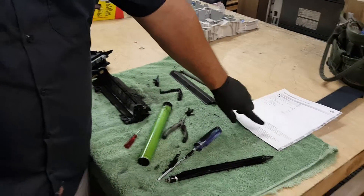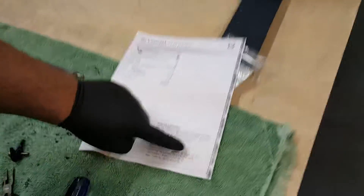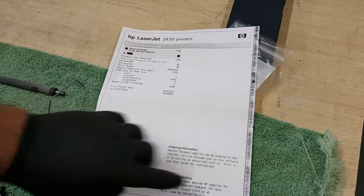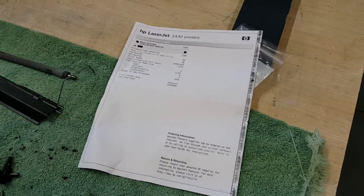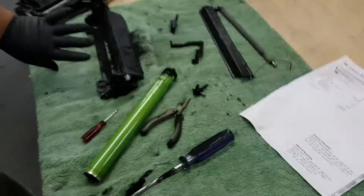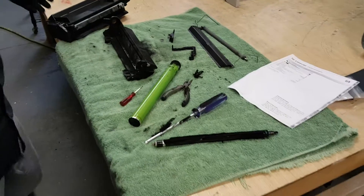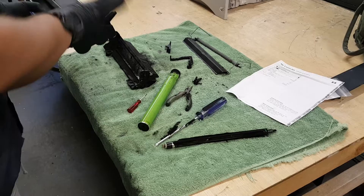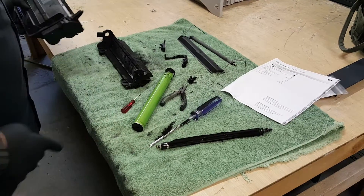What you can see here on this page is the image defect you get — it's spilling out that side. So if this is coming out on the printed page like this, and this cartridge were turned over — if this is the way it went in — you can see this side would actually be over here if it was turned upside down, and you can see how it's dumping.